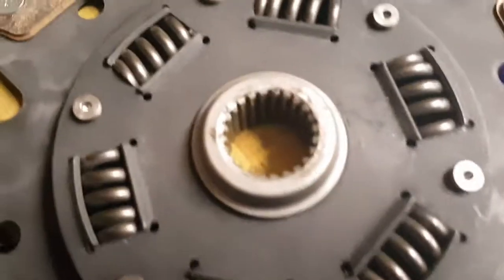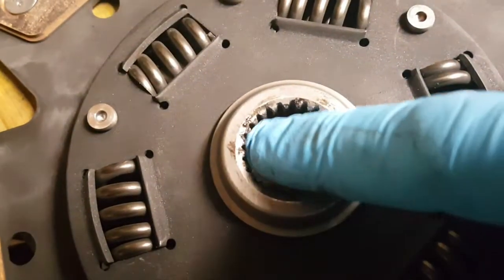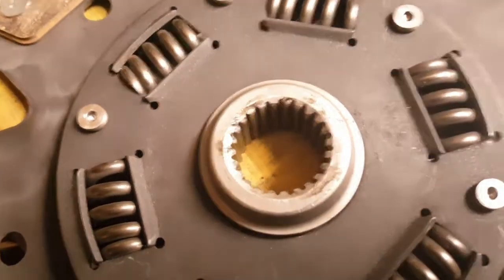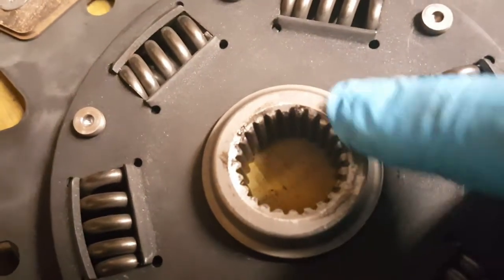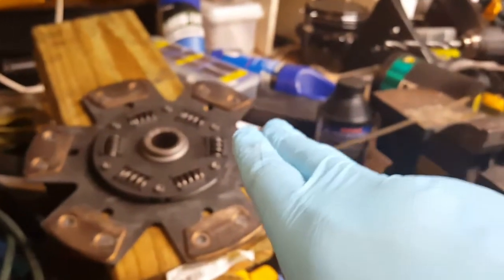But when this engine was trying to shift down, it hit these front splines. It's kind of right here. So it had hit there. It knocked the alignment out on the spline, and for the clutch and flywheel and stuff. So obviously when I went to put the input shaft into the transmission, it wouldn't line up.